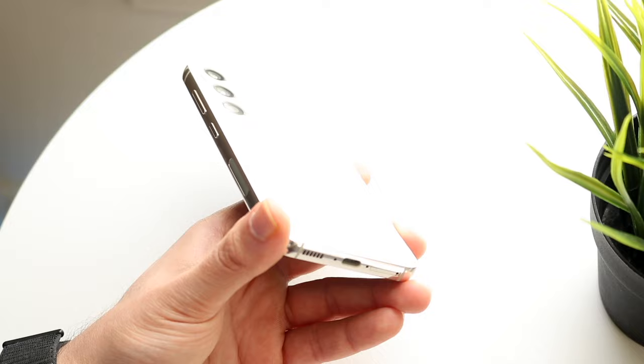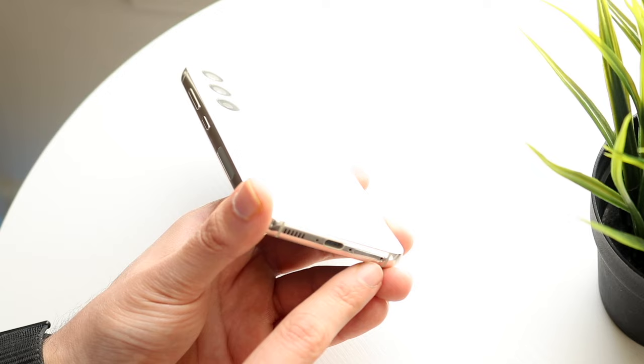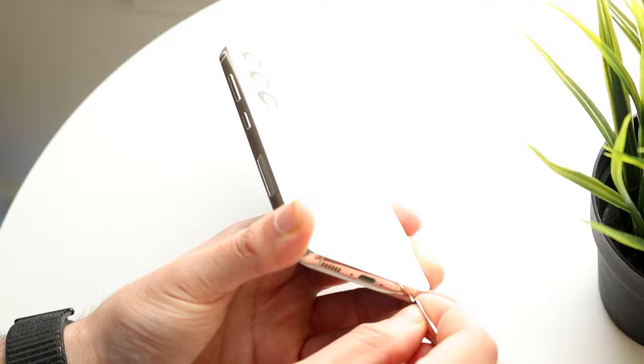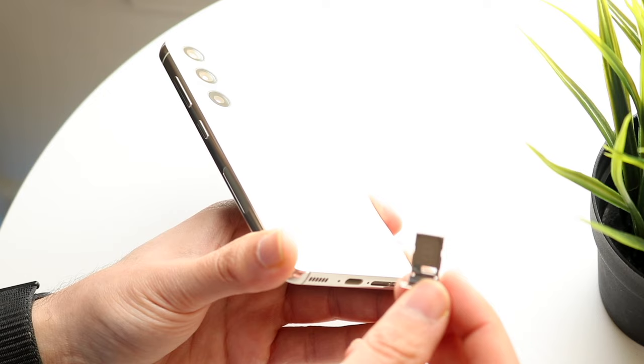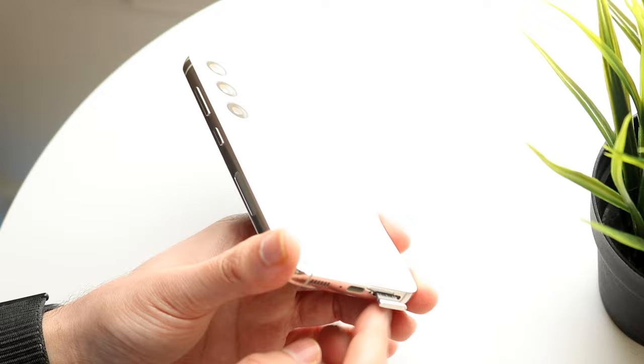You can use a needle or anything that will fit into the small hole on the right side. Please do not put it in the hole closest to the USB-C charger — put it in the hole that is the furthest one away. Put that little SIM card eject tool right in there and go ahead and eject the SIM card. Place your nano SIM card inside, and once you're ready, place it back just like so. Once it's popped in, your SIM card will be detected if it's suitable.